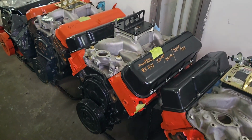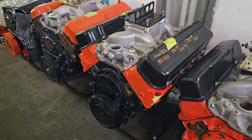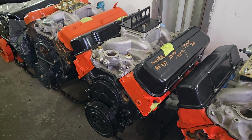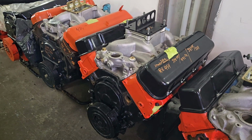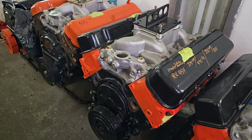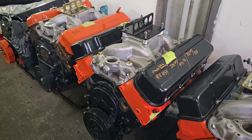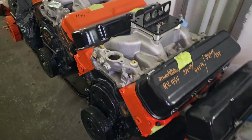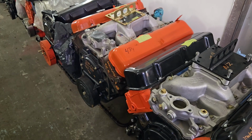This is what I call the Motorhome 454. You've seen this on my channel if you've watched any of my videos. I've made some upgrades to it. It started out at 378 horsepower, just stock with rocker arms and an intake. Then I switched to some smaller combustion chamber 396 heads, and we got about an extra 10 horses out of it that way. So that project is in progress. That's a series that I'm doing of a Motorhome 454. I gave $1,000 for that motor, and it was an extremely clean, low mile motor.